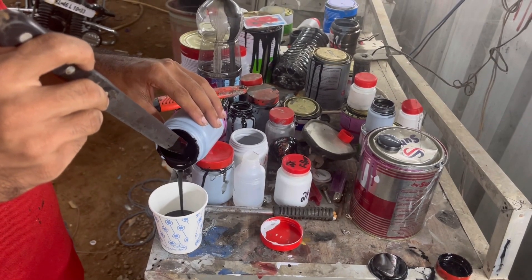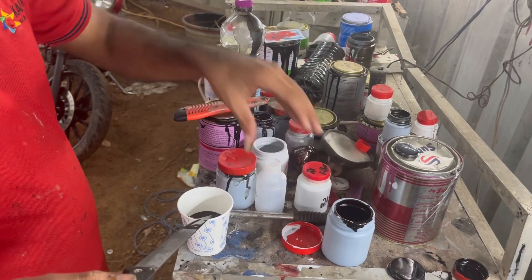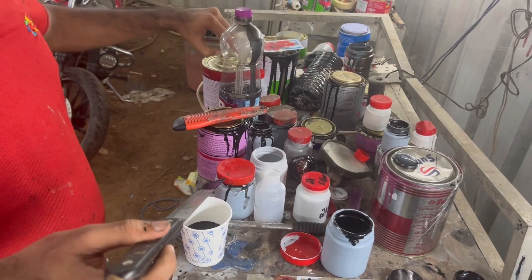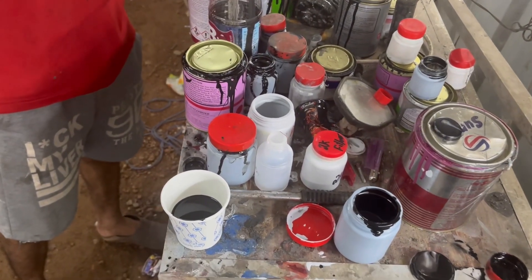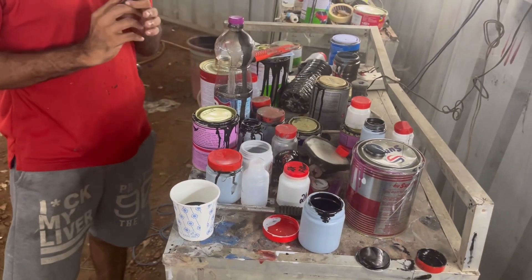For any metallic shades, it is highly important to mix with the proper thinner in the proper ratio in order to have the desired output. We are using PU thinner at a ratio of 60 to 40. On this particular day it may change to 70 to 30 or even 50-50 on colder or hotter days — that's totally subjective.